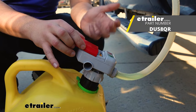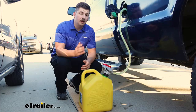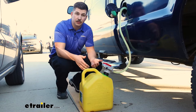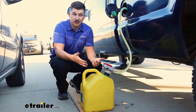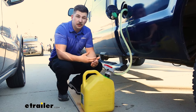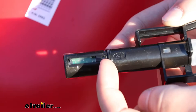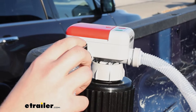You will need four AA batteries to power it. You can use two if you're in a pinch, but four is the best option because it delivers the most power. With everything hooked up, we just hit the on button and start to pump. This pumps at 2.4 gallons per minute, and the same goes for the one with the racing jug adapter. Because it's fighting gravity here, it won't quite reach 2.4 gallons per minute, but it is pumping really well. With the auto-stop nozzle up top, we don't have to watch it too closely — once it's full, it will shut off. That sensor is right here in the nozzle with a stop line, and whenever fuel reaches that line, it shuts off.